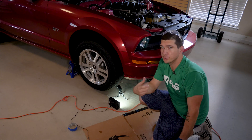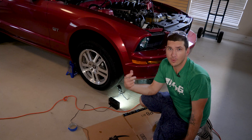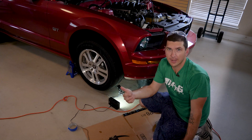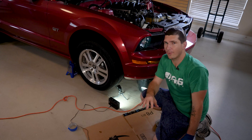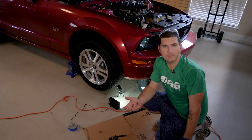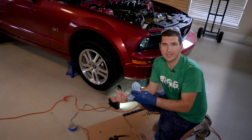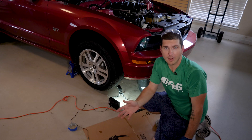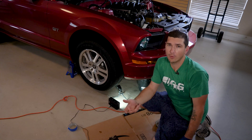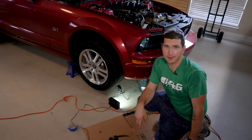Once that's done draining, or once your container gets full, just go ahead and close that valve, then either swap out to a new container or just close it back up — the system is going to be most of the way empty. Now there's still going to be a lot of liquid in there, so if we were to pull off the water pump, there would still be liquid because it's being held up in different chambers in the system. We just want to get the majority of it out so when we do pull hoses or the water pump, we're not having a huge mess.